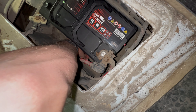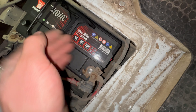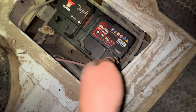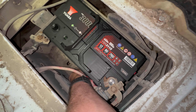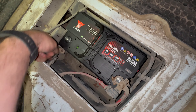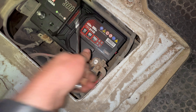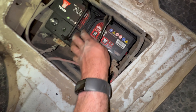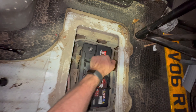Fit the clamp at the bottom of the battery. If you're having trouble getting the clamp on the side of the battery, you may not have fitted the battery correctly. There's a lip at the bottom of the tray that it slides into, so try moving the battery left and then back right. Tighten the positive before connecting the negative. If the battery is fitted correctly in the groove, then you won't be able to move it.